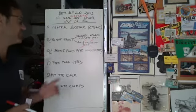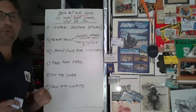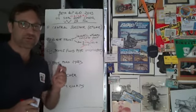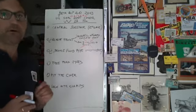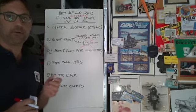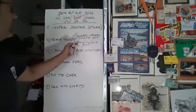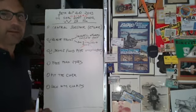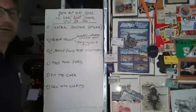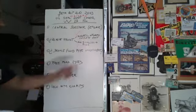Then the strategy issue. It's impossible to remove the front end in one piece if you are alone without help, and would damage maybe the clamps of the yoke, which is the part of the bike where the stanchions are locked. So the strategy will be remove the wheel and then each stanchion of the fork. So this is not good, this is good.